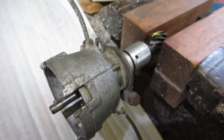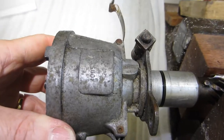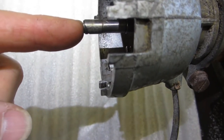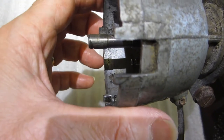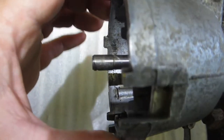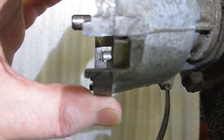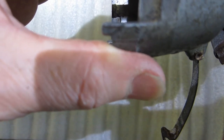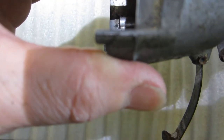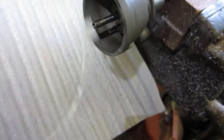Here's the job that I should have done years ago really. I'm just taking the distributor apart — this is a Lucas distributor — and checking to see if there's any movement, sideways, of the shaft relative to the body. I'm trying to move the body sideways, and I'm pretty happy as there isn't any — none that I can feel anyway. Maybe there is a very, very small amount, but nothing wobbly. That's quite pleasing.